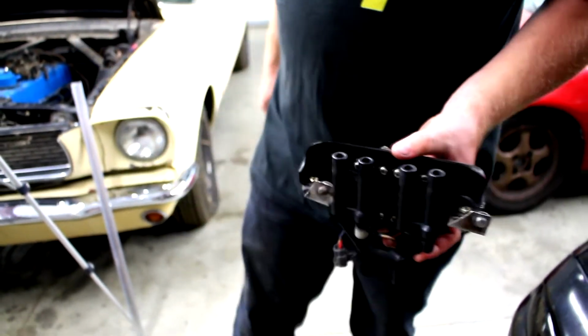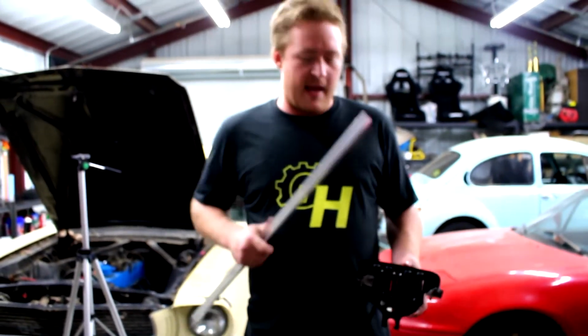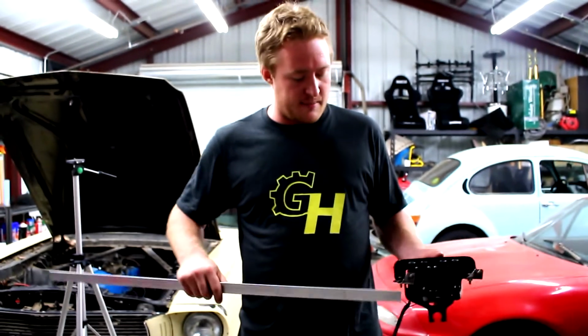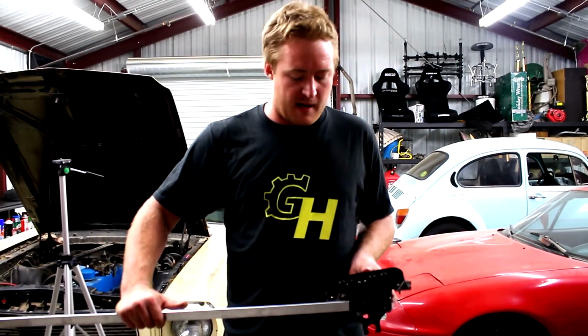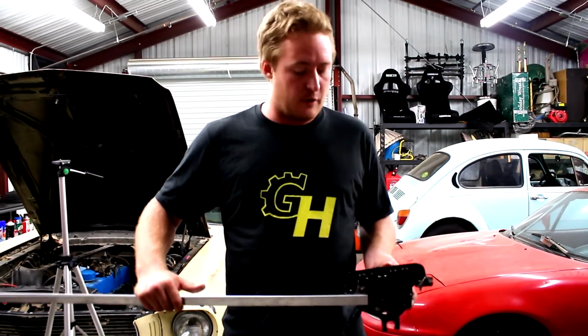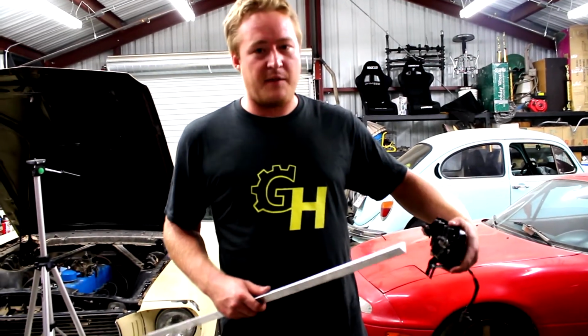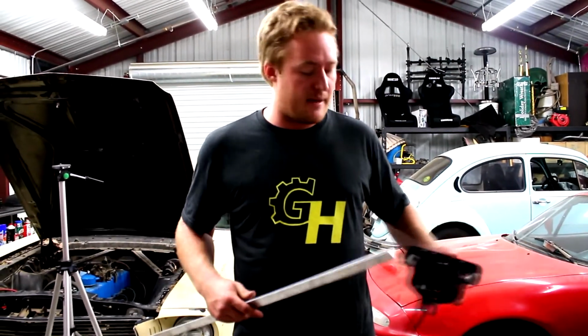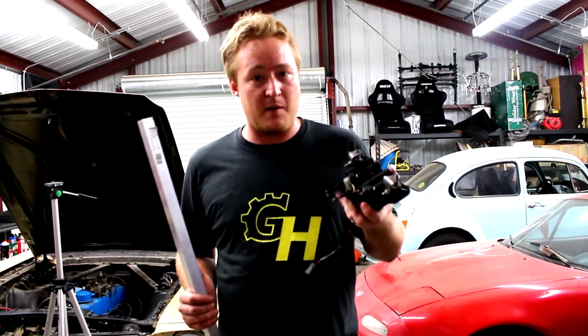So this time I have an angled piece of aluminum, so I don't have to worry about hammering an angle onto a flat piece of metal. I'm just going to go ahead and line this up, take a measurement, and I think I'm gonna move it over about another maybe 1/2 or 3/4 of an inch, and that should be enough for the clearance I need. If you want to do something like this yourself, just set your coil pack down there and take some rough estimates. Get as close as you can and figure out where this thing needs to be. This was totally fine before when I did not have the coolant reroute, but now that I have a coolant reroute and all the extra stuff back there, it doesn't fit anymore. So let's get started.